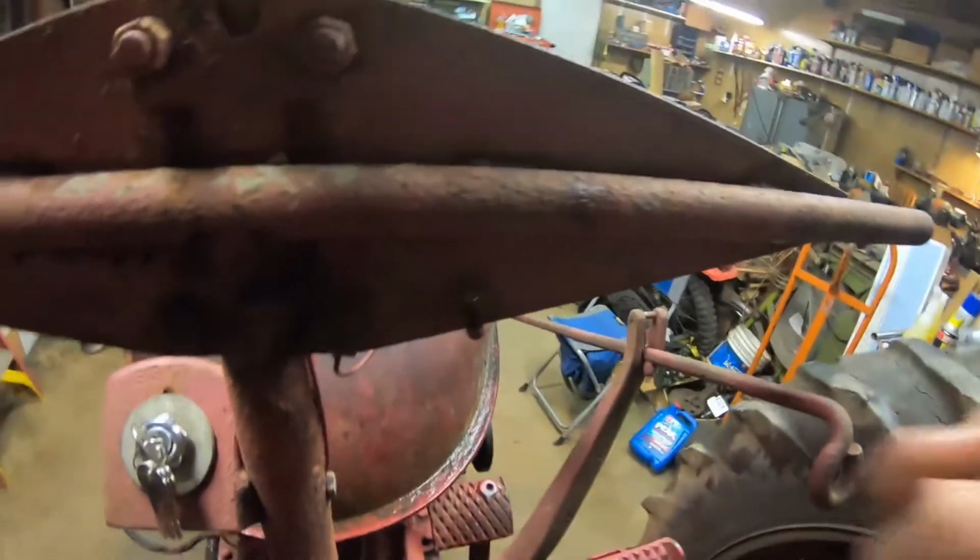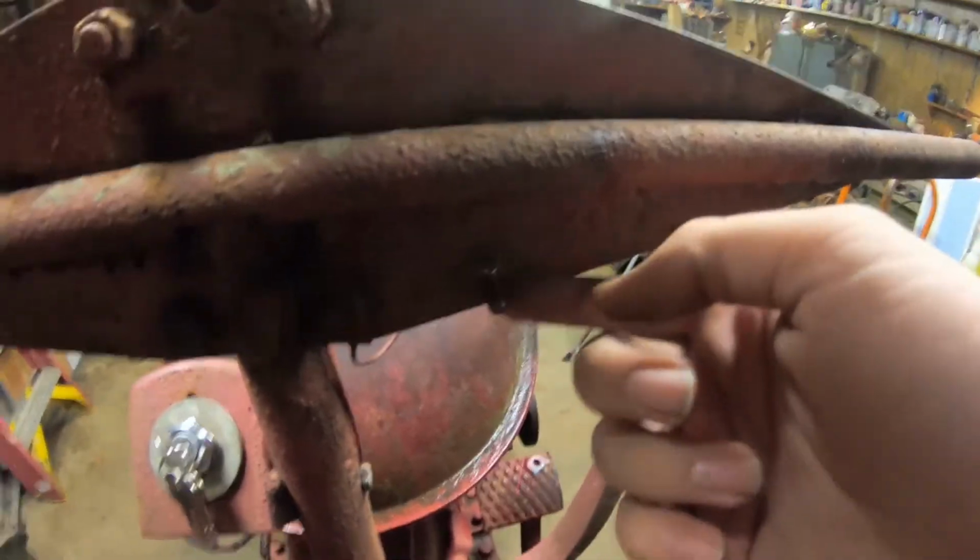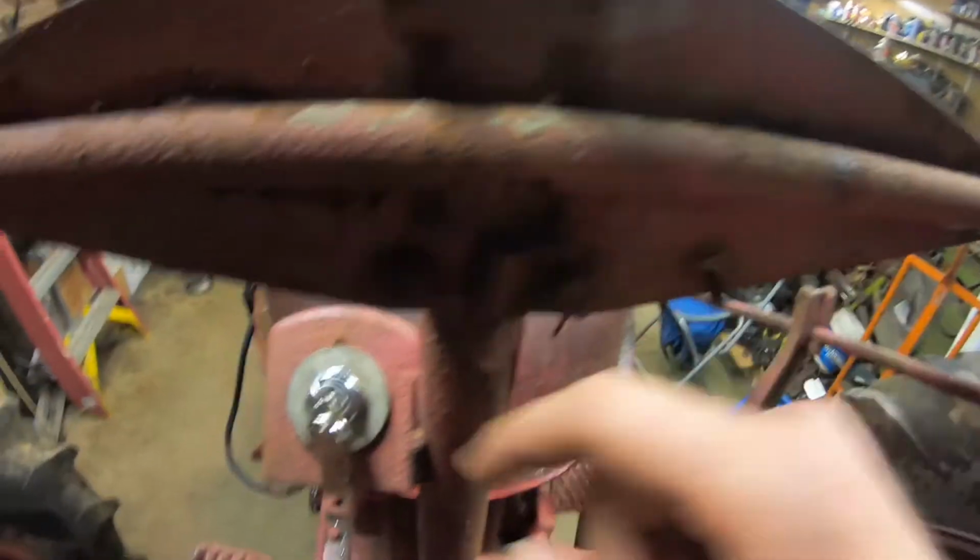Right now, I still have the magneto grounding through this toggle switch instead of through my ignition switch. I'll end up needing to get another relay to make it work through the ignition switch because they work the exact opposite of each other. But it's not a big deal. We will do that another day.